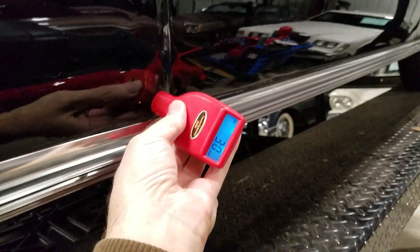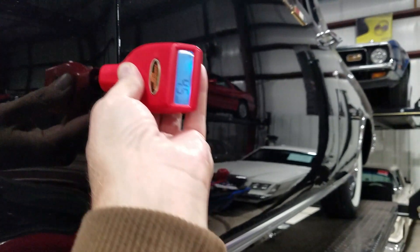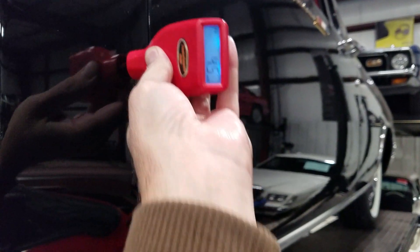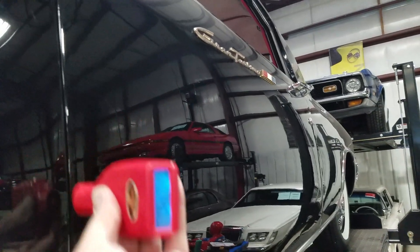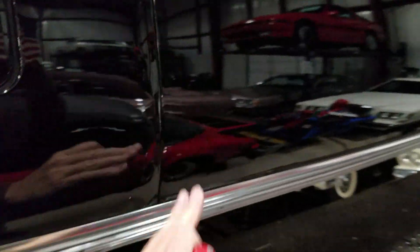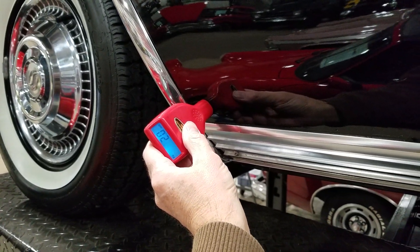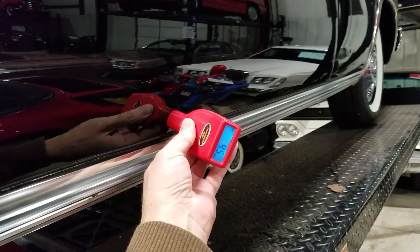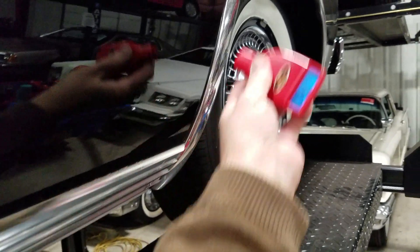2 and 3 and 5 on the gauge. Even down here in this area of repair, or an area they decided maybe not to get into too much, I'm getting really good readings all around it, so it's not like it's packed full of Bondo. It's hard to get a reading right on the seam where it's kind of rolled. So that right there is probably the least desirable spot. I'm doing this for the owner who's watching this video thinking about buying this car. I've got still photos of this gauge in at least 50 or 60 spots, and all of them look like this — 2 to 5 mils of thickness, which is really, really like less than two dollar bills worth of paint and primer on the vehicle, and it's this way all over the vehicle.